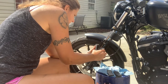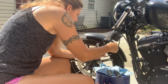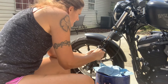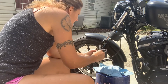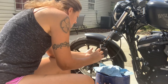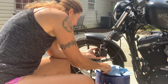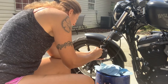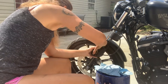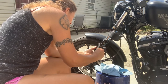You should also inspect the boots — make sure there's no cracking — and then push it all the way down. Now I'll install the brake pads back into their respective positions and make sure they fit right into the little clips on the end of the pads and the little spring on the end of the caliper. Make sure it gets all the way in there. They're almost like springs — you kind of have to push a little bit, but the caliper pin will keep everything where it belongs.